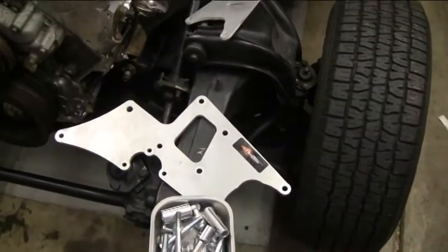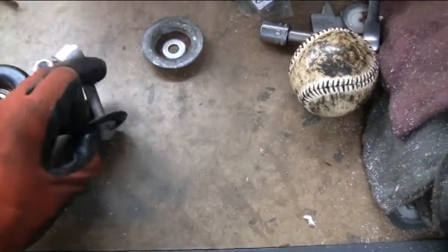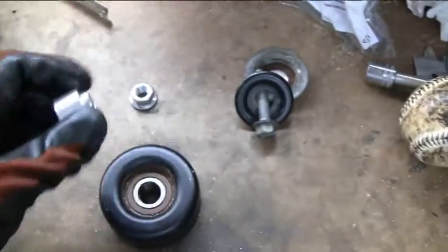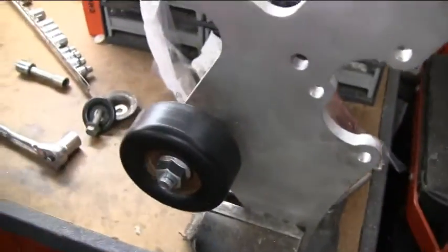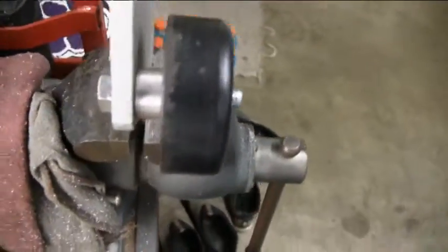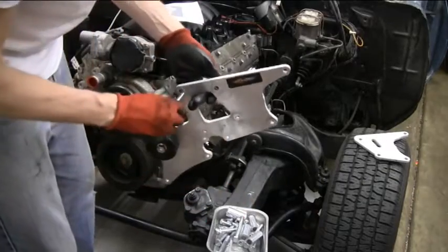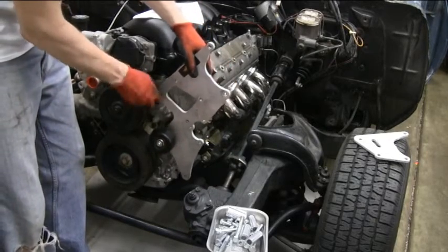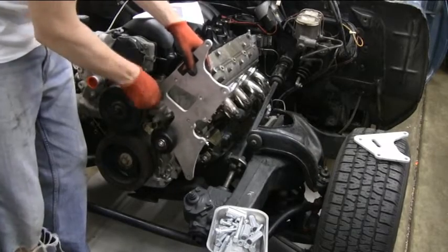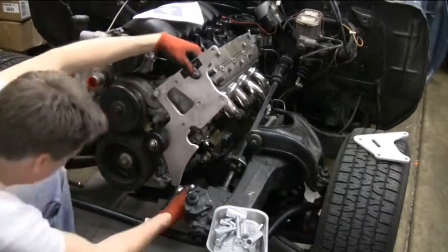The bracket setup requires an idler pulley and tensioner from my old setup. When I bought the motor I took that pulley off — I don't need the spacers or bolt, just the pulley. LS Brackets comes with this spacer here. It goes on with these longer spacers first. I'm not using washers since this is all dry fit — it's all going to have to come out anyway. I'm pulling the engine out to do the front end work, but I want to make sure everything is set up so I won't have fit problems after everything is painted up.